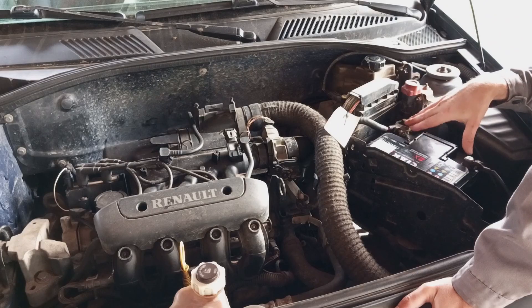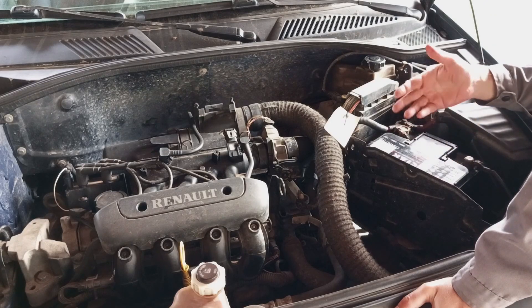If everything is okay with alternator voltage but you have to recharge the battery again after an hour, it's best to buy a new battery. This is a simple procedure you can surely do on your own. The main things to remember: plus on plus, minus on minus — whether connecting or disconnecting the battery or the charger — always take care not to swap the terminals. Red on red, black on black. I'd recommend investing some time to learn this. It goes in the same line as knowing how to change a tire or do simple checkups on your car. Knowing this may get you out of trouble numerous times, especially if you have a battery charger in your toolkit.